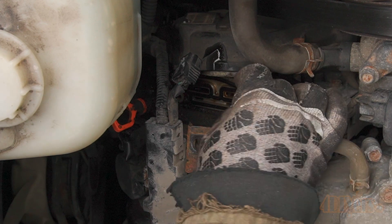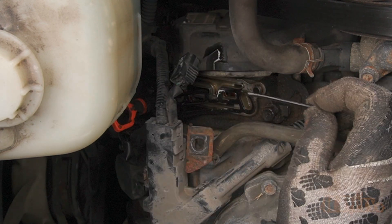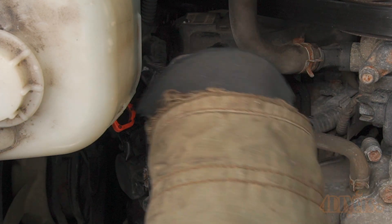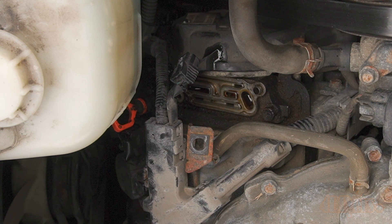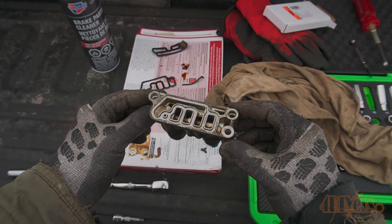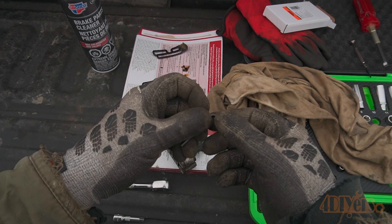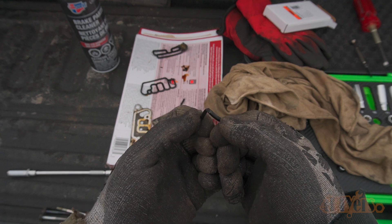Another gasket will be below this. You'll need a pick or a small screwdriver to pry it up — take your time and don't damage the gasket groove. My gasket was quite hard and ended up coming out in pieces. Also be careful not to drop any debris in the gasket groove or oil passages. I did try to clean up the solenoid to reduce the chance of any debris falling in during assembly. The solenoid also had the same type of gasket, which I have already removed. As you can see, the old gasket is extremely brittle and it doesn't take much to break it apart.